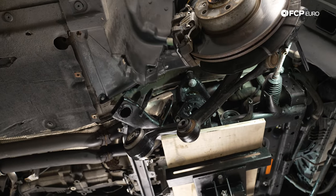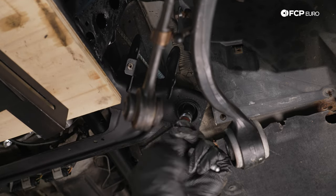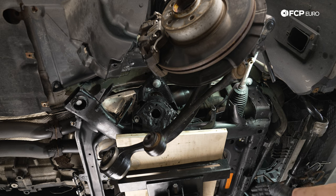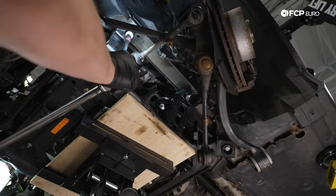All right, now let's head to the back bolts. Those still remain a hex head. Those did not change, unlike the forward ones. All right, with all six of our pieces of hardware started, we're gonna torque all of them to 108 Newton meters. We'll start with the two front E14s, move our way to the middle E14s, and then the rear 17 millimeter bolts.